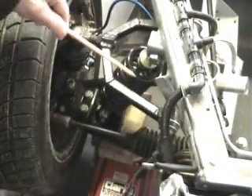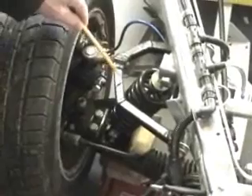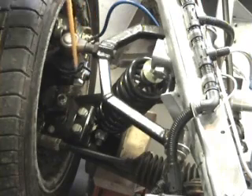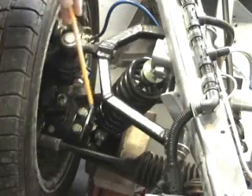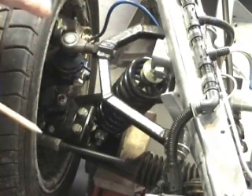When we said we'd take 10mm off the steering rack mounting post height, we were assuming you've not made any modifications to the top arm. Some people have moved the top arm further back by cutting the post down and putting a spacer in to improve the caster angle. But as you've increased the caster angle, you've also lifted the mounting arm the steering rack sits on — so you wouldn't need to take 10mm off, more like 5mm. Don't worry if you've taken too much off, because you can shim them back up until you get almost zero movement on the laser point.